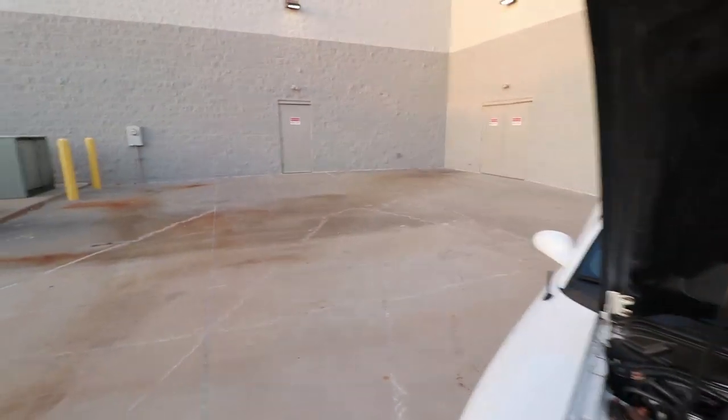And as far as the exhaust goes, it does have like a ghetto mid pipe. It's not a branded mid pipe. That's what it has. No cats whatsoever after the long tubes. Long tubes, X pipe, and then it has SLP resonators, man. The resonators, they're not the mufflers. The resonators are straight through, man. All the piping is 2.5 inch back besides the mufflers. The mufflers, I think, have a 3 inch inlet. And then I just have these 3 inch pipes in the back, man.